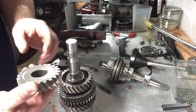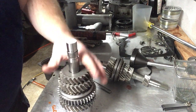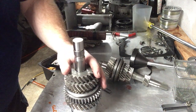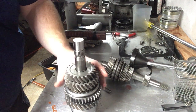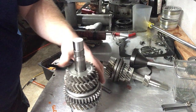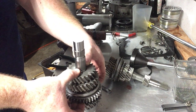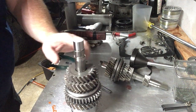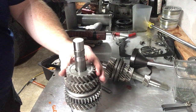I put the bearing on at the same time. This is an aftermarket main shaft with an aftermarket gear, so it just falls right on. On stock you have to press it on, which makes it more difficult because you have to go back to the press. When dealing with stock, you have to press third off. You can't use first because there's a clip holding the one-two hub on, so usually I use the one-two slider with some angle iron to push it off — the keys tend to fall out — but that is how you get third off.